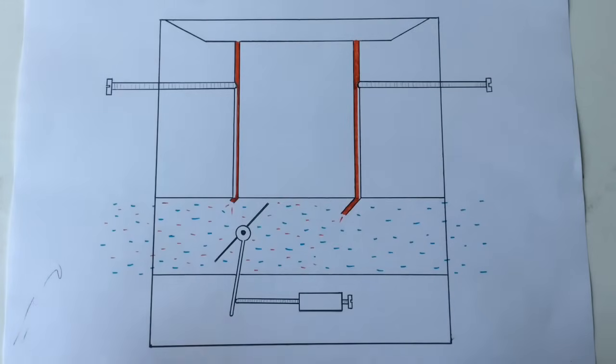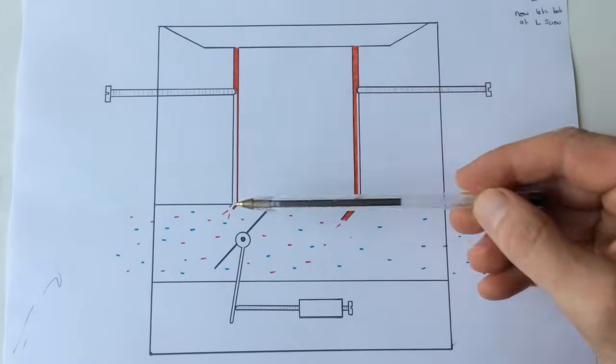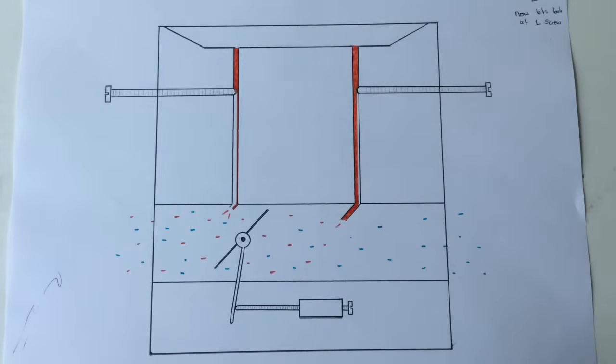So it would be a weaker mix and a lot leaner - you'd see the efficiency going down and the engine start to just change slightly. Now screwing the low screw in even further, we can see we're getting to a really lean state, and because we've got less fuel going through there's less combustion...